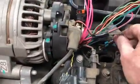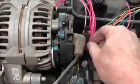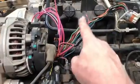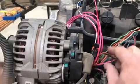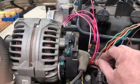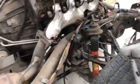And then I had not hooked up the injectors. I had not soldered in the injectors on this side yet. And you can see the amount of overlap that I've got there is because this is where it fits really well into the injector harness. So I'll be cutting those wires back and shortening them, and then I can base the rest of the injectors off of that length. Okay, and then we come down the passenger side of the frame again.